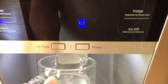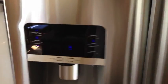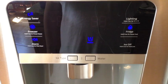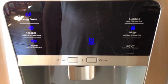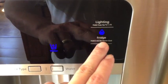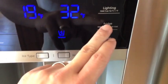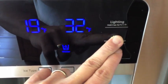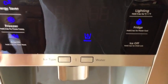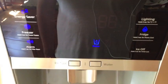We've gotten water — I'll run it for a couple more minutes, then wrap up with some final thoughts. Back to the dispenser: note that it takes about 24 hours for it to cool down enough to dispense ice. I'm trying to get the whole unit to cool down faster by invoking the Power Freeze mode and Power Cool mode. You do that by holding down each of these buttons for three seconds, and it should come up — Power Freeze and Power Cool. Once they reach the desired temperature, set with the freezer or fridge button, it'll be ready and will turn off those modes automatically.